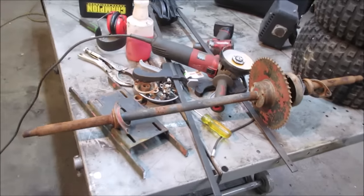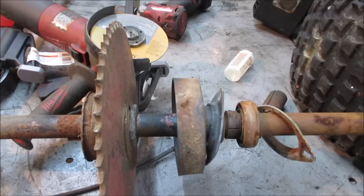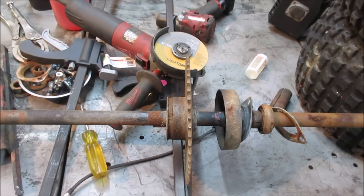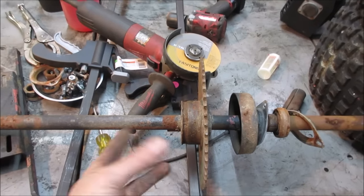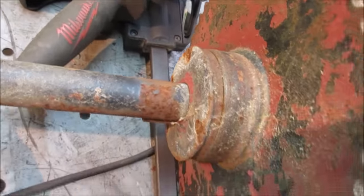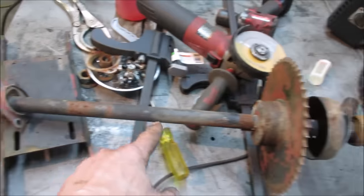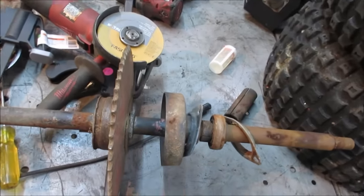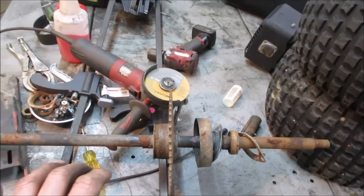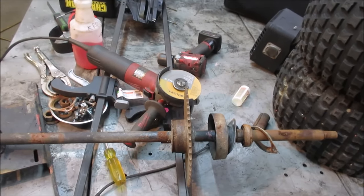Actually, I think we're going to jump over to the axle for a little while and take some time. And now I don't know what I got to heat and beat to get the bearings off of here, because these both have to come in about 3/4 of an inch to fit back on the frame. The sprocket's bent. It'd either be replaced or try to press it straight. And of course, someone's been hammering on the flange of that to try to move it. These guys are all seized up. So I'm going to go take some time, clean all this up, get all this stuff off of here, the brake drums out around, and get all that cleaned up so that we can get the axle put back up underneath it. So we'll have an idea where that plate can fit.